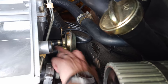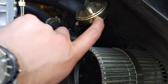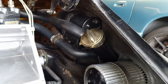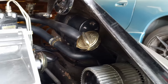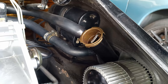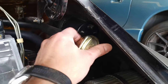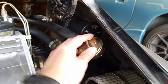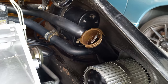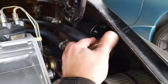The CIS has various mechanical air-operated valves back here — one is an auxiliary air valve — and all of these have vacuum connections, either tiny vacuum lines or connections to the larger rubber manifold back here. The oil cap could also have a leaky seal causing a vacuum leak. A sign of this: when checking your oil with the car running and you take off the oil cap, you should hear your idle change then recover. When you pop the cap back on, the idle should change again and reset. If the car stalls or idles really poorly when you remove the oil cap, you more than likely have a car that's not tuned correctly and could have other vacuum leaks.